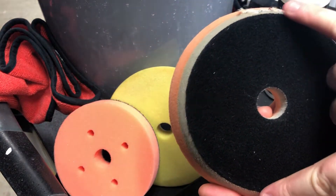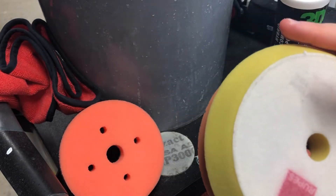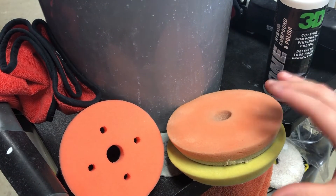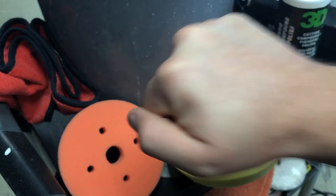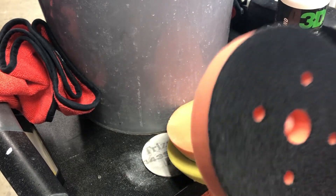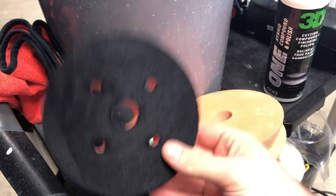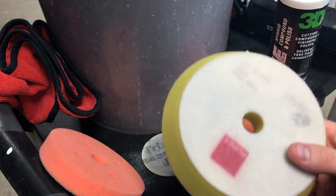This foam here is five inches across, same as a Rupes pad — five inches across. But as you can see, the foam sticks out further than the pad. The reason it sticks out is it helps reduce vibration, gives you more stability when polishing, so your machine doesn't start doing that. With exact fit pads, you've got five inches of velcro and exactly five inches of foam, which should prevent the machine from stalling out.